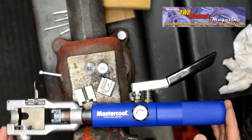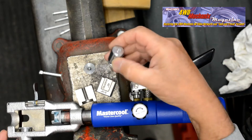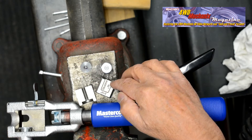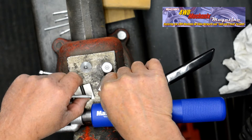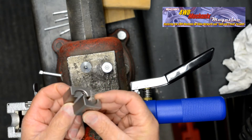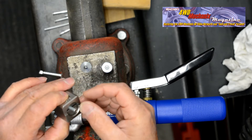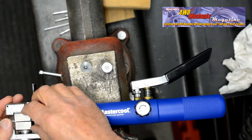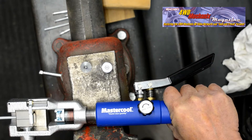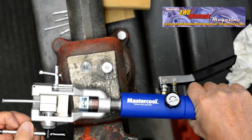The tools involved are the Mastercool handle and yoke. This is a Hydroflare tool with the 45-degree inverted flare adapter and cone adapter with the 45-degree inverted flare die. This die set is designed for the inverted 45-degree flare on a 3/16" tube. We begin by inserting the tube, carefully cut squarely and deburred both inside and outside, into the yoke end of the 72475 tool. The die and tube can be squared up and the handle with the large compression area is tightly secured.